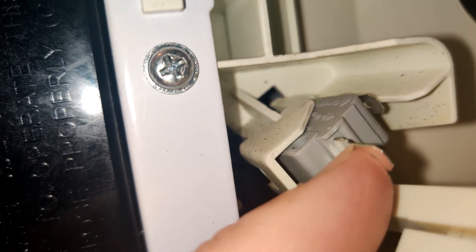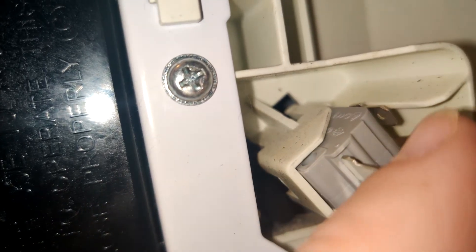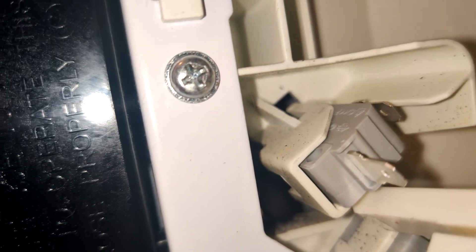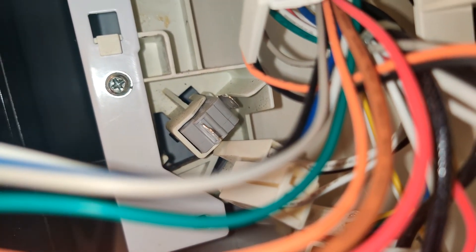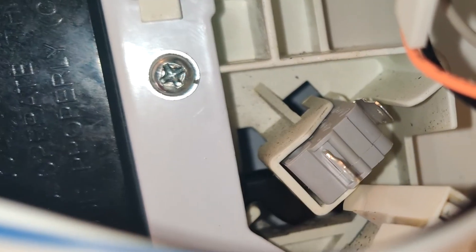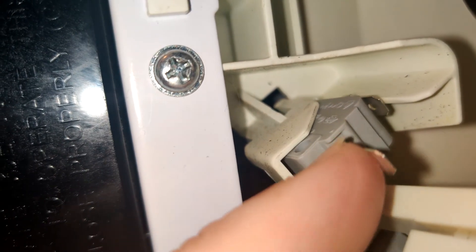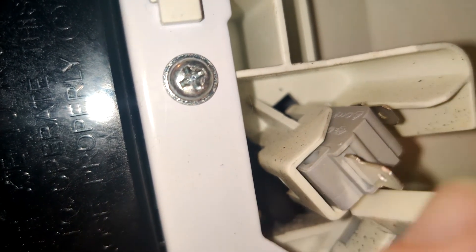So the purpose of my video is to show a trick — a very simple modification — to shim out the bottom switch so that when opening the door, the switch is released slightly later. Check out how when I close the door, the door latch pushes this monitor switch backwards in its holder. There's simply too much play in the position of this switch as it seats in the holder.